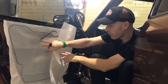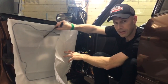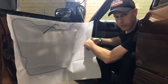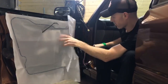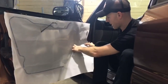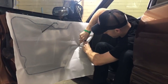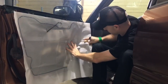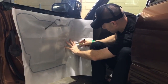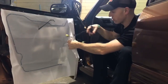So you can see up here, I've put a slit in this to allow our door rods for our door lock and handle opening mechanisms to come through. We've also got our wires here, so what we're going to do is just cut a simple slit in it, big enough to pass all these plugs through. So we've got this positioned — you can feel up to where that is and then choose a spot, simply cut a hole and then you can pass through all your leads.